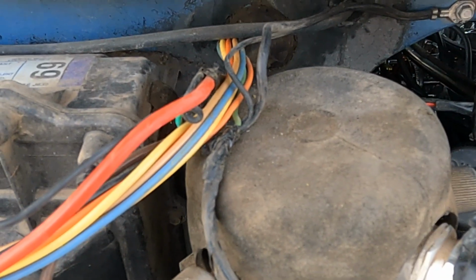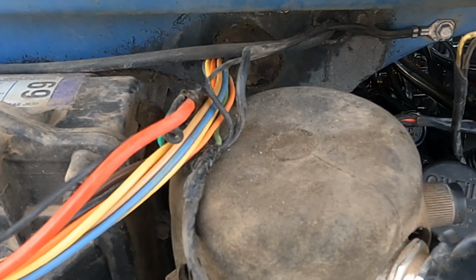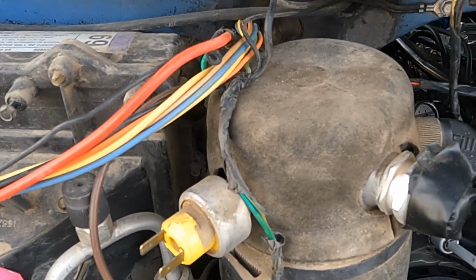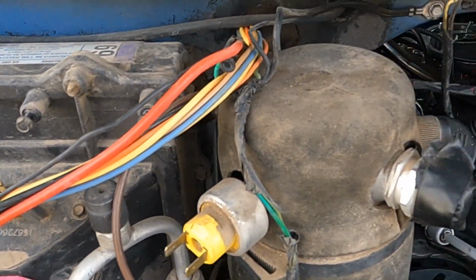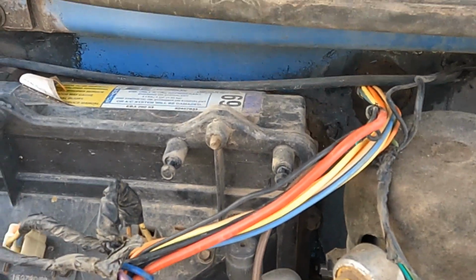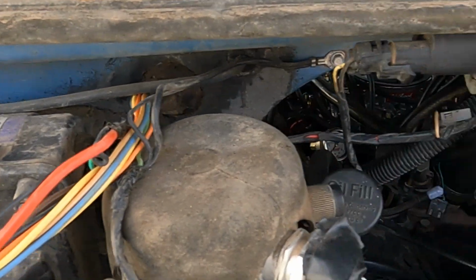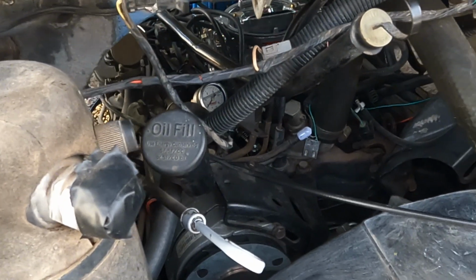Next I'll probably open up the dash, go to the switch. I think I might have to look up a wiring diagram to figure it out. See what the signal wire is for this relay, and it's going to take a little more work than just changing the blower motor, because that's not it. But I'm sure I can figure it out. So hopefully I get back on this next weekend. Go pick up some parts this week, and that'll give me time to look up a wiring diagram for this. It's out of a 94 GMC van. I don't have any manuals or anything that go up that high. So I need to go ahead and close everything up for this weekend, get all my tools cleaned up. And I think that's it for the van now.